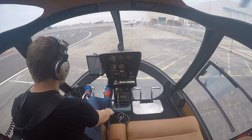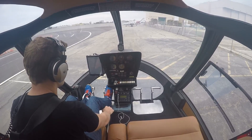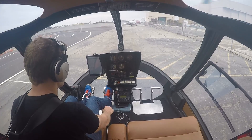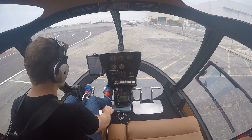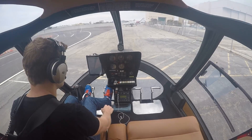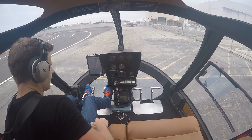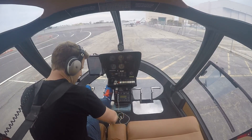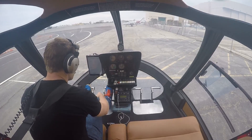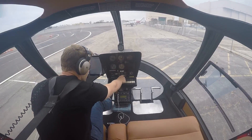You'll hear some unsettling squeaking noises, perhaps. Engine RPM will dip a little bit. Squeak, squeak, squeak, squeak, squeak. Fully engaged. Gentle up — and if this lays flat, we know the clutch is fully engaged. Now we'll pull this up to 1,800 and let the cylinder head temp warm up to 200.